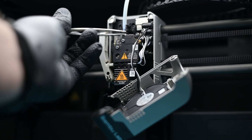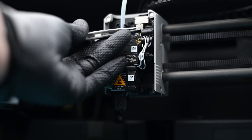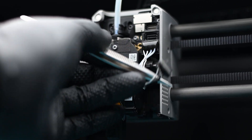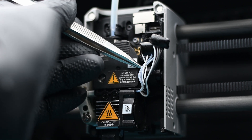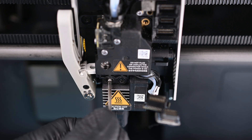With the power turned off, I'll pull the front cover away from the tool head. The fan is at the top of the three primary connectors inside. I'll also disconnect the two cable harnesses from the hot end. You may notice a little printed bracket I have around these connectors — this is a handy little alignment jig you can print to ensure the cables connect back properly. As I mentioned in my previous extruder teardown, it's surprisingly easy to connect these incorrectly.